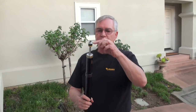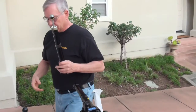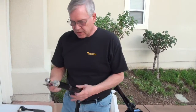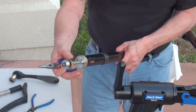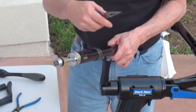This is your air spring that's contained inside the stanchion. Just like on the other damper side, we've got the keys here on both sides — the same kind of bushings top and bottom. If you had to replace the bushings, they're done exactly the same way as we did before.